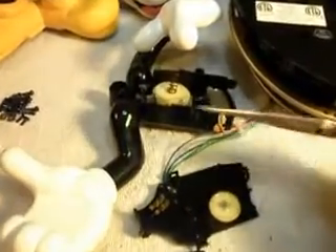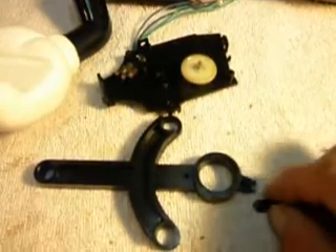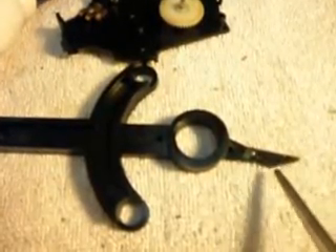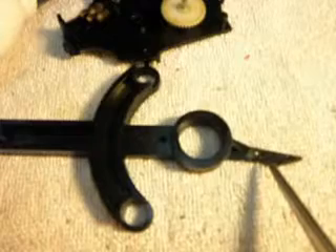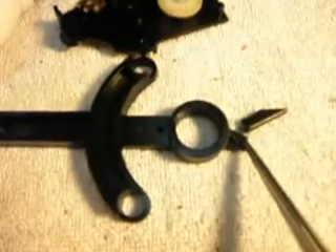The spring does come off after parts break because the spring is attached, and that's what makes this a weak point here on the guide. There's a little hole here and they put some hot glue on there to keep it together and keep the spring in. Basically, when they did that, they kind of shot themselves in the foot in the engineering department — because you have quite a bit of pressure on this guide and they don't give you much material. So it's really not all that sturdy. If Mickey falls off a table or his head gets slammed a little bit, that guide breaks right off because there's a hole drilled in there which made it weak — it made a weak point.